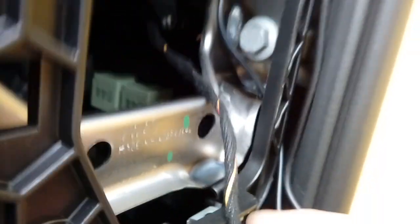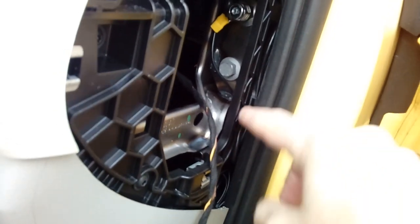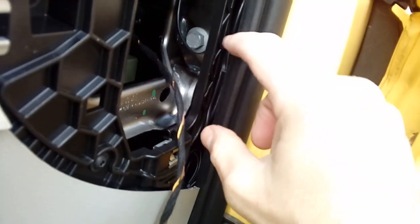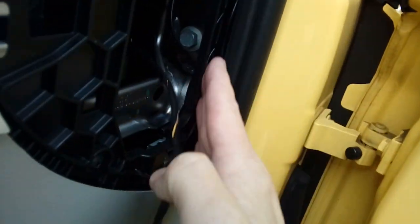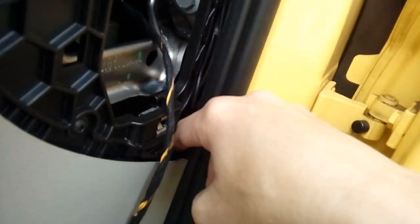So we're now going to thread the cable down here towards the fuse box. Any excess cabling, we can either cable tie up or sticky tape in a bunch, and we've tucked it neatly down the side, out of the way, round the back here, and down into the crevice. But like I say, we now got the fuse box location, so just move that. There's your power cable coming down into the footwell, ready to go. If I can get the camera angle correct, there, up under here.